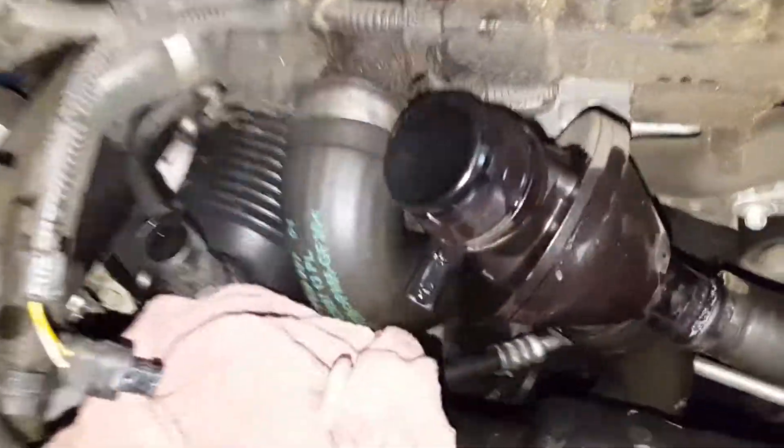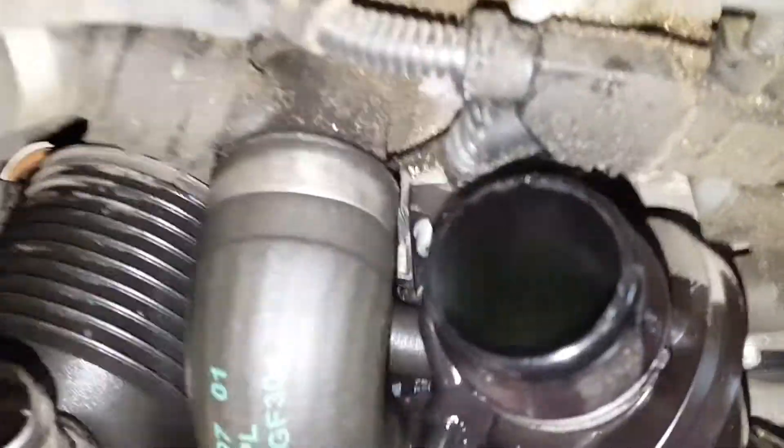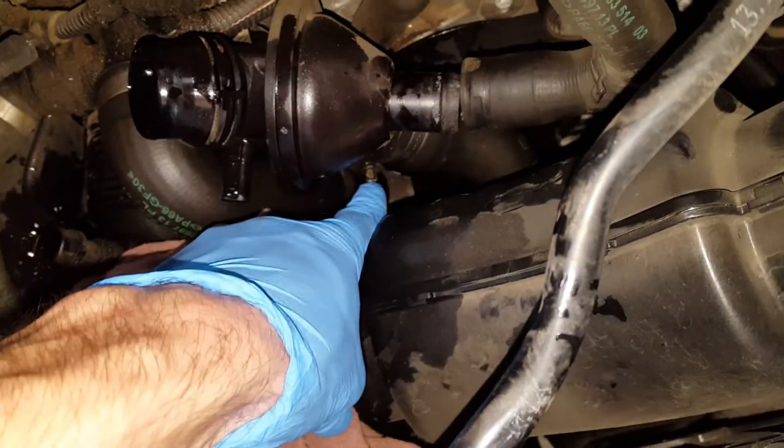As far as the actual bolts, you can see them right in there. They're Torx. I'm using a T27 to get to those. Once I get those two completely out, I can move this enough in order to get a flat blade in here to remove the final clamp.